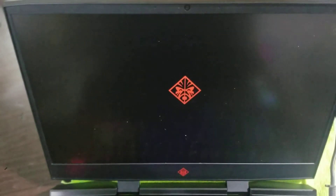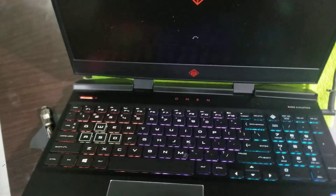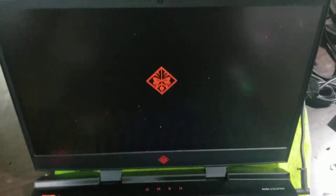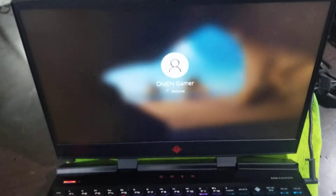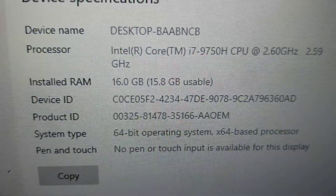Display is there, so we will check if it is showing 16GB. Sometimes you change the RAM but it shows only one — one RAM will not detect. So in this case, if I put two 8GB sticks it could show only 8GB. Before packing up the laptop, just make sure everything is going up to the mark. Let's take the properties of This PC — you can see it is now 16GB.